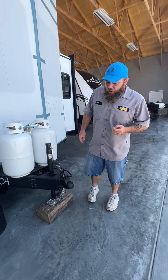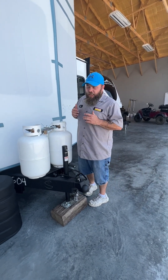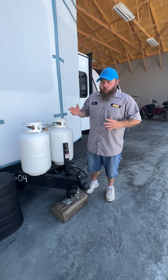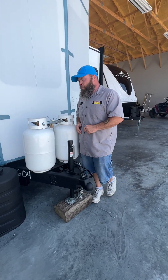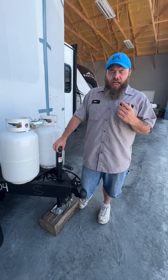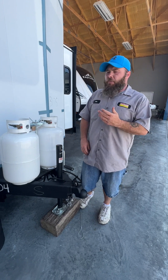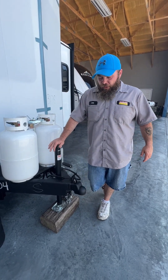I do have to make note that this is considered to be a park model, so this is not meant to be hooked up and just taken everywhere once a week. This is a one destination location camper. Once you've unhooked, you do want to make sure you're leveled from side to side first. Let that tow vehicle help roll into some blocks if you need to level from side to side, and then level front to back with these jacks.